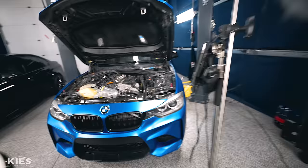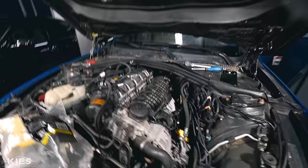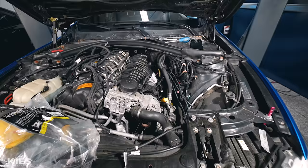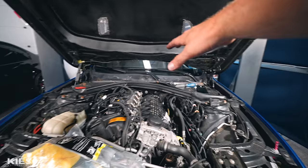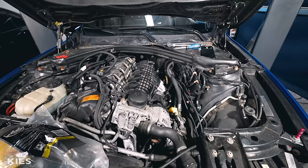Just want to give you a little update on where I'm at. I got all the wiring for the most part out of the way, then I unhooked the DME to make sure all the connections are out of the general area. Typically when you do this you disassemble the whole plastic portion with the aluminum brace under it, but I've done this a few times now where you don't actually have to do that, so I'm going to skip that step.